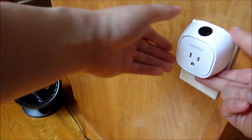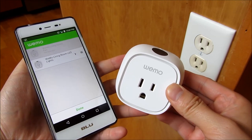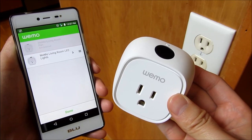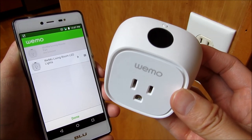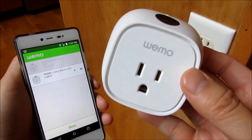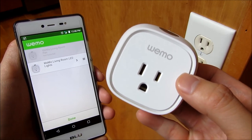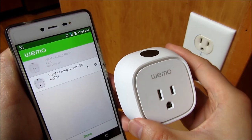I am going to reset it. Before I reset this Wemo and reinstall it from scratch, I want to talk about how this Wemo installation actually works. This Wemo device is actually a Wi-Fi hotspot in itself. What you're going to do is use your phone and connect directly via Wi-Fi to this device. Once you connect via Wi-Fi to this device, you're going to set up the Wi-Fi password of your network into this device, and then this device will connect to your internal Wi-Fi network. What's tricky for most people is they don't realize that this Wemo is a Wi-Fi hub itself, and you're going to have to connect to it in order to program it directly.